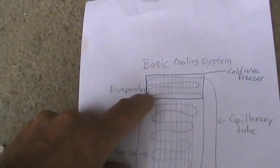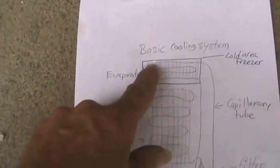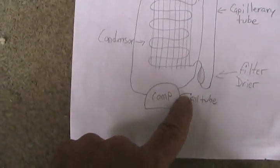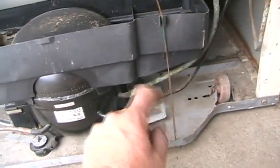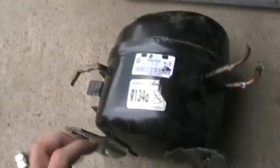The liquid Freon then flows up that tiny capillary tube all the way to the top, into the evaporator — that's the cooling coil in the freezer. It has fewer coils than on the back. It percolates its way down and comes all the way back to get recirculated into the input of the compressor, or the suction side. There's always a dead-end tube on the compressor where they filled it in the factory, pinched it off, and welded it. The suction tube brings gas back in, and the high-pressure tube pushes gas out to radiate its heat into the room.